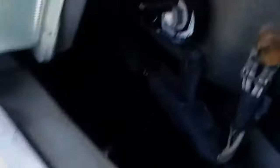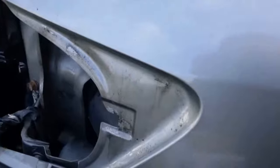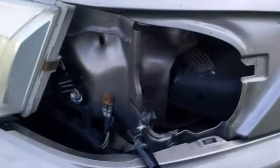Once you've connected the connector, notice that back here there is a clip that has to line up with this notch, and then the other clip we were working with before goes into that little bracket. This lines up with the hole up here where the push pin was. And what were those paper towels for? Well there's always a little bit of crud that's hard to get out when you're washing the car — now that you have the marker light off you can reach in and clean all that out. You also have access to a ground here which I'm going to take loose, clean up, put some dielectric grease on, and put it back before I put the marker light in place while I have room.